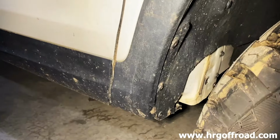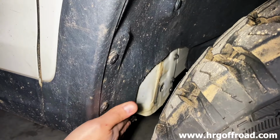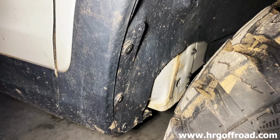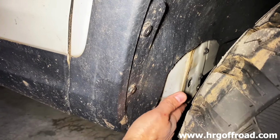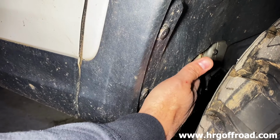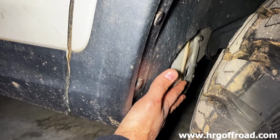The reason for that is, if you want to show this real quick, if you go over 30.5 inches on your tires, you're going to rub. I know some guys want to go bigger than 30.5 inches, which you can't. It's going to rub unless you re-engineer it like a couple people have. With a sledgehammer. Well, actually, you can't, because this is part of the unibody subframe. Oh, no. And part of the ACE body structure.